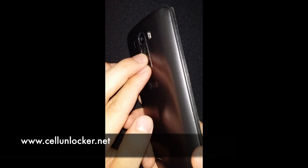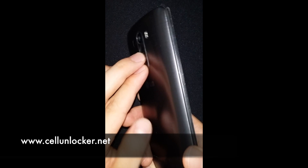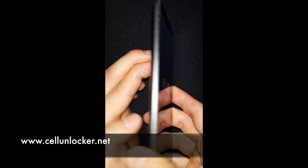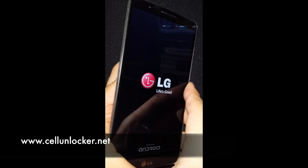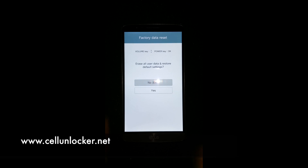So now we're going to do this here. We're going to press the power button and the volume down button at the same time simultaneously — three, two, one, go. Now we're going to look for the LG logo. We see it. We let go. Hold it down again. There we go — now there's the factory data reset screen.